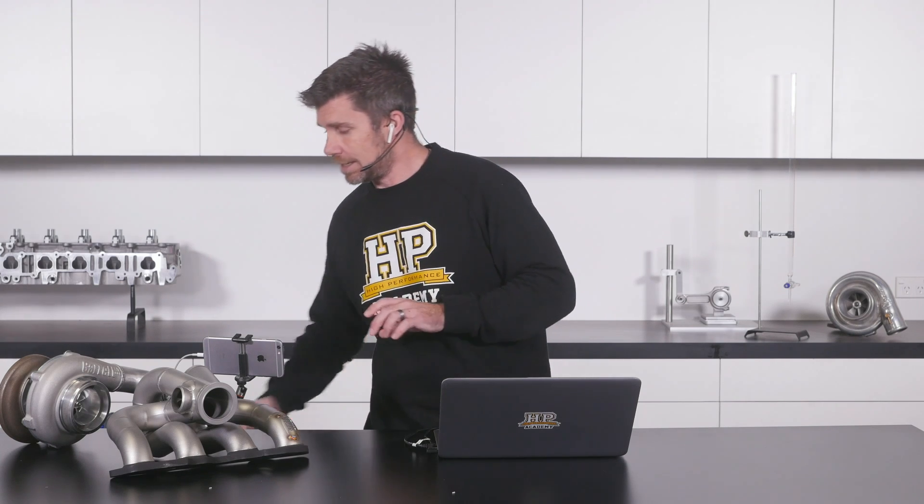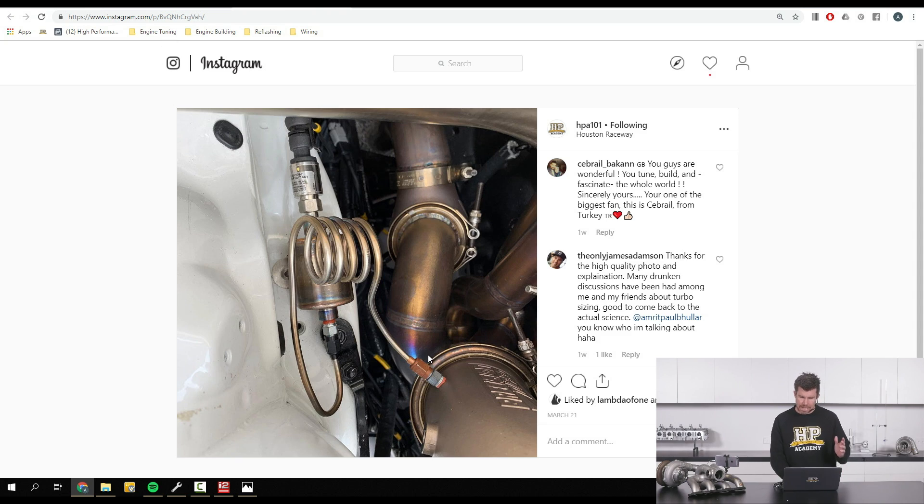We need to get rid of some of the heat before the exhaust gas makes its way to that chamber. To show how that looks, let's head across to my laptop screen. This is a car I photographed when we were at TX2K, showing the integration of that exhaust back pressure sensor. The sensor is taken straight off the exhaust housing on a precision turbocharger. There's a short run of tubing, and the bending in that tubing is used to help get rid of heat before it reaches the damper canister, ensuring our sensor lives a long and healthy life and we get a smooth, usable exhaust back pressure signal.